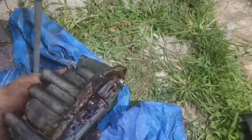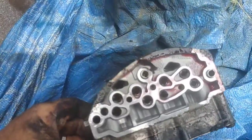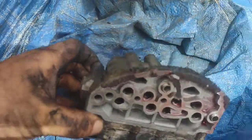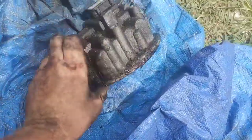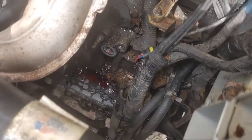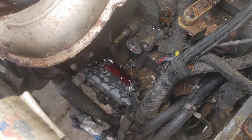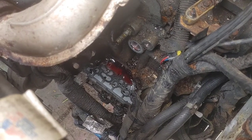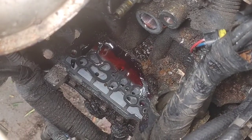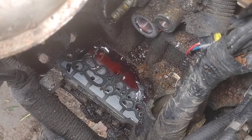You did notice the leftover gasket right there on the bottom. That, and you also have three studs. You see two right there right off the bat. That's actually holding the transmission valve body right into place where it's supposed to be. So that's why you want to wiggle it just a little and not pry it uncontrollably in beast mode. Okay, there's your gasket right there. You will need to scrape all that off. It does come with the new set. Great job, guys. And you saved yourselves buku bucks.